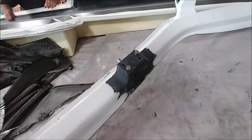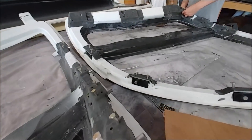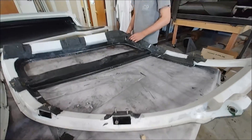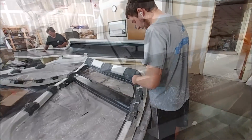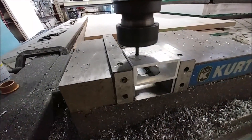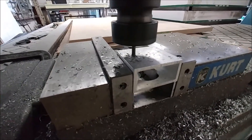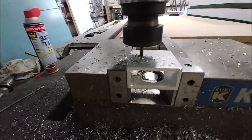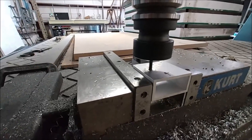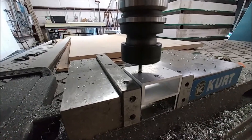I still have to do a little trim work around where the last layup was to allow the actuators to go through their full motion — something I'll be working on tomorrow. For the doors, I'm using my new two-fluted end mill to cut some holes in a piece of rectangular aluminum tube that's going to become a quadrant on each door for actuating all the door locks. Here's the second one just getting underway.